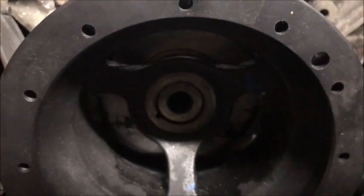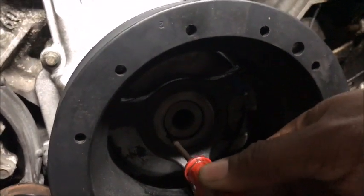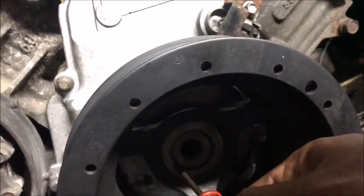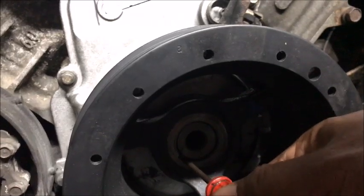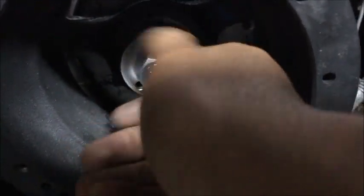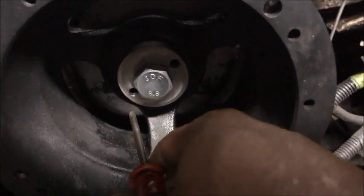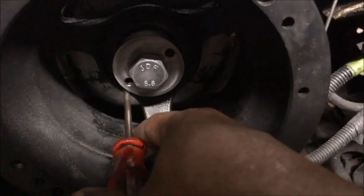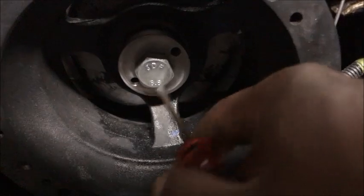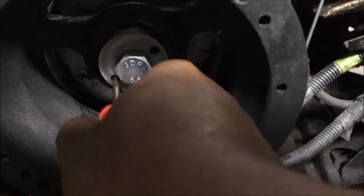So let's get to going. The first thing I'm going to need is a little screwdriver that's big enough to go somewhat into the hole, but not through the crank. I will loosely install the tool and bolt. I'm going to put my screwdriver on one of these holes. I know that the opening on the pulley is around here somewhere — there it is right there. It'll fall right in place. Right there. See?